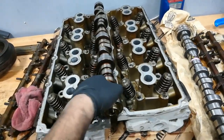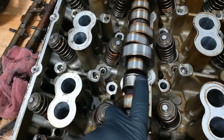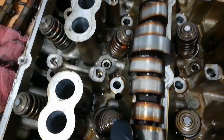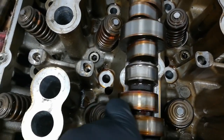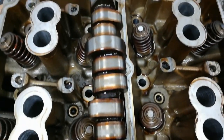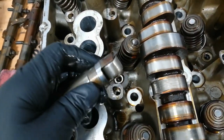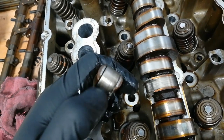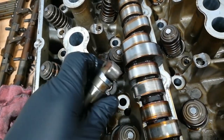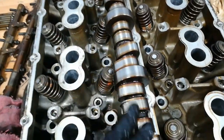I got the stock cam out of the truck and here is the culprit. This is the intake lobe for cylinder one and it has just been grinding away at that lobe. Every other lobe looks pretty good - it's just this one that got ruined. Here is the lifter that was riding that lobe. It started actually grinding into the sides and the roller - it's really pitted and chewed up, just eating away at that lobe. So this is the source of the mysterious misfire.